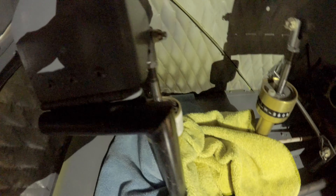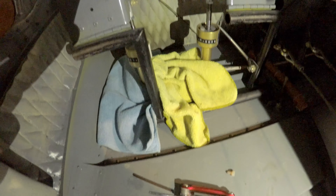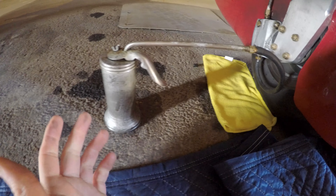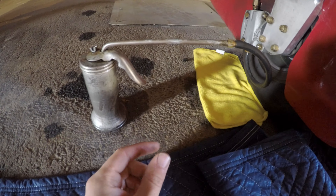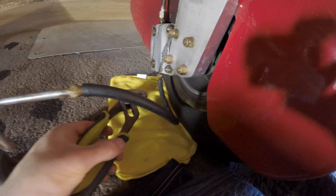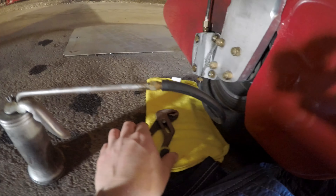There's that little plug I pulled out — it just comes right out at the top. I put some towels down underneath so that if it overflows a little bit, it won't make a mess of the cabin. I'm going to pressurize from the bottom here with a pretty simple oil pump. The canister is full of that 5606 fluid, with a hose connecting it to the bleeder barb on the bottom. I'm just going to loosen that up — I don't have a wrench that small, so I'll use channel locks — loosen it up, then pump the fluid through, checking up top to make sure it doesn't overflow.